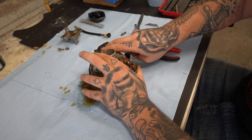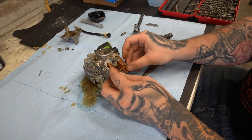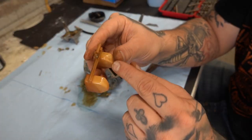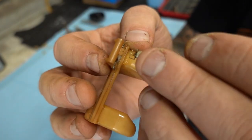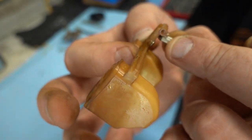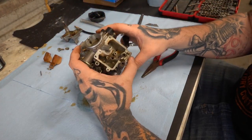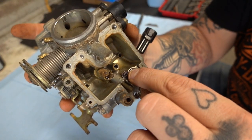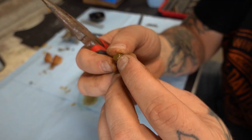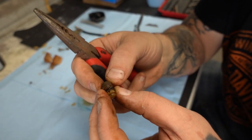We're going to pop off this emulsion tube and main jet — that thing is stuck up in there. Out of the emulsion tube, it's pretty nasty. And then there's the pilot, and it's pretty nasty, but that's okay. Now we need to get this off — you got to be real gentle. So I'm going to get this float out of the way. You want to make sure that your floats were not holding fuel. This is what they call a tunable float. That determines where this needle engages and disengages as the float moves up and down, and it controls and regulates the flow of fuel. That also has a seat right there, and it's held in by that screw. And that's your screen for your float, and it looks like there may have been some trash, if that hasn't been explicitly obvious.